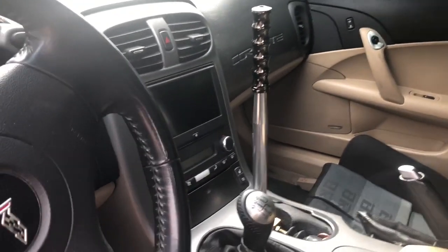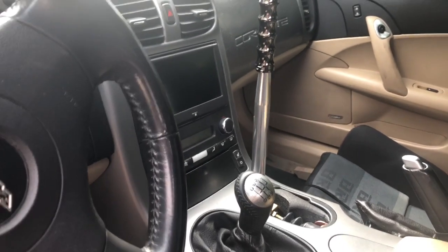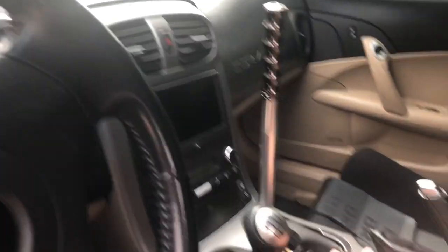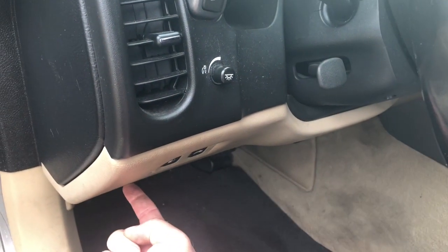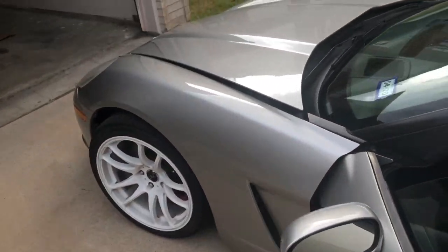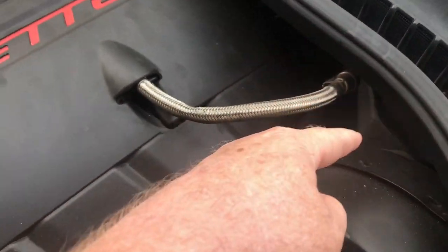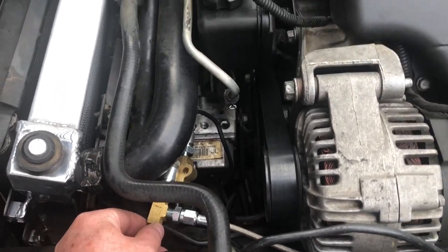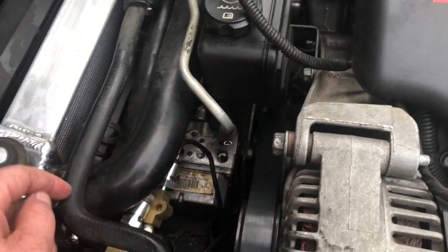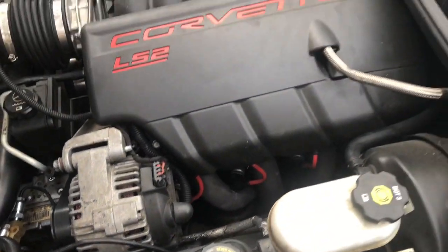I have a hydro brake — I did a whole video on it but lost half the footage in editing. The master cylinder is routed underneath the dash and goes through a hole up under the hood. This is the inline hydro, so the lines come out from here going to here, and it deletes the ABS. I took all the ABS lines out and teed them off, so there's no more ABS, and the lines go to the rear wheels.